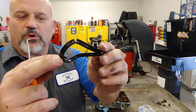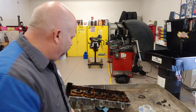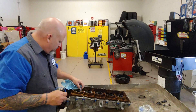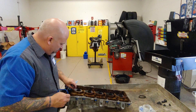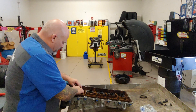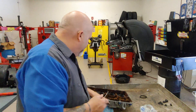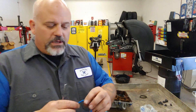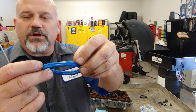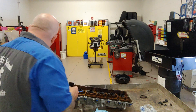You can probably see the cracks in the old seals pretty clearly. The new ones are going to be nice and supple and they're going to fit right in there beautifully. You want to clean those grooves out — clean, oil-free, and dry. Most o-ring type seals like this have something on them that helps grab the part, and this has a little corresponding lip with some contour to it. So as we extract the old ones, make sure we put the new ones in with the correct orientation.